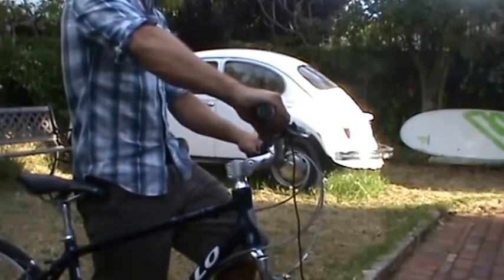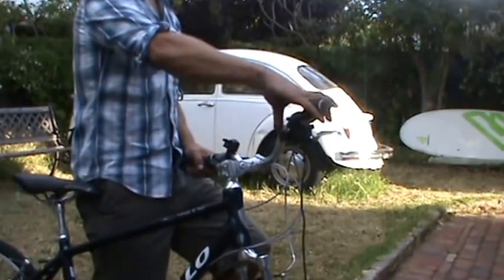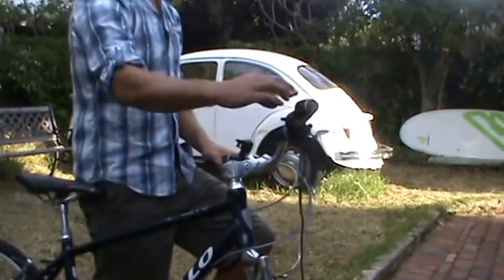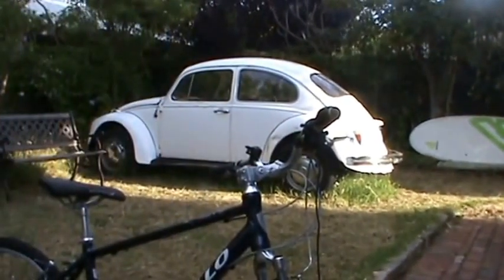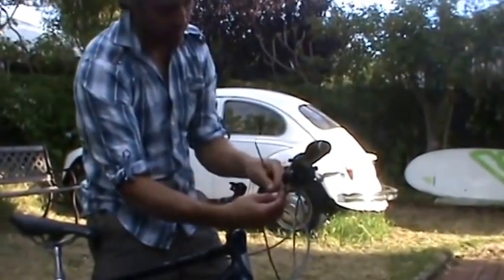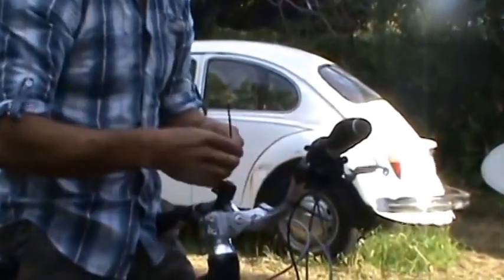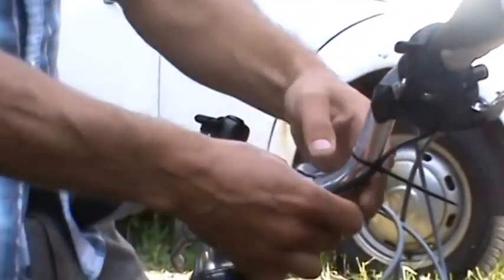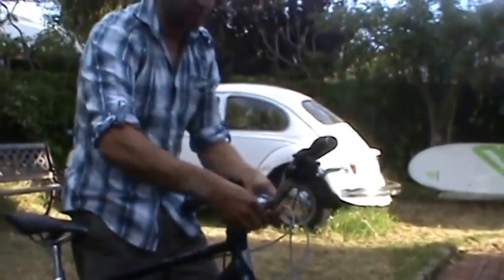And that all seems to work quite well. You have a thumb throttle there and grips here. Some people like cruise control, so they don't put the stopper in and have it sitting tight against the grip so it sticks there. It's not the safest because the power will be on. It's a little bit graduated — a little bit of power, full power. It's quite comfortable just to rest your thumb against it. But here when you let it go it releases and there's no power. Usually just to keep the cable nice and clean, leave just a little bit of slack and put a cable tie there. Make sure it's all moving and not in the way, then put one just under here as well.